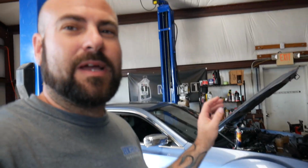But he had just paid somebody else to put a 6.4 cam in it, non-MDS lifters, and put the car back together. Well, after we got the valve cover leak fixed and the exhaust leak fixed, we could hear some unsavory noises coming from the engine. And I went into the tune file and turned the 4-cylinder mode off. Well, when I went to turn it off, it was already turned off. But anyways, we knew something had to be wrong.